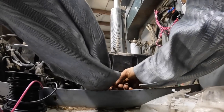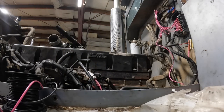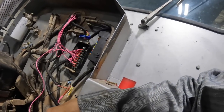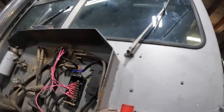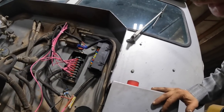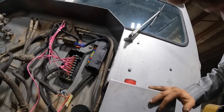I'm going to wire the 1939 to the data link, get a power and a ground to the data link. I've decided I want to use a fan relay and a fan solenoid for the fan switch. I've got five more relays to work with. I've got to figure out what to do with the start relay.